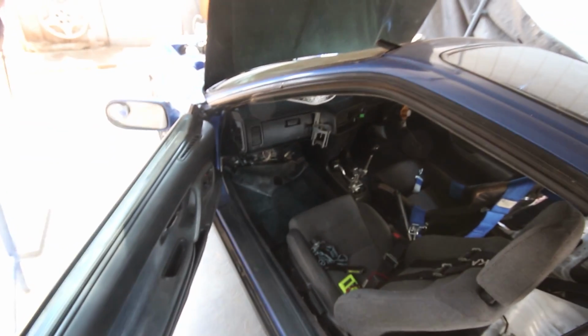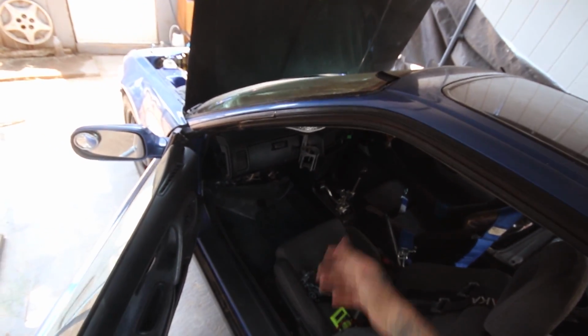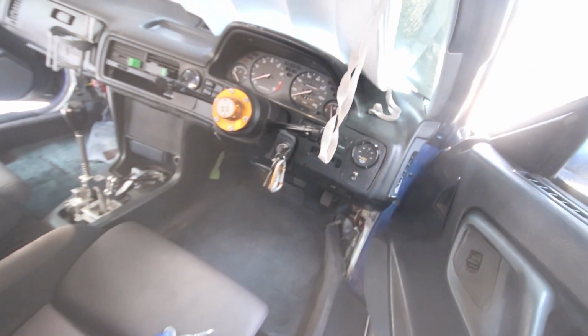Car wasn't starting, had no power at all. I charged it, tested for voltage, had battery voltage, wiggled something under here. I noticed a few wires were out of place. Put it back, so let's see really quick if we got power. No power again. Okay, Doge found it. I disconnected my ignition when I was doing the clutch pedal to get the master out.